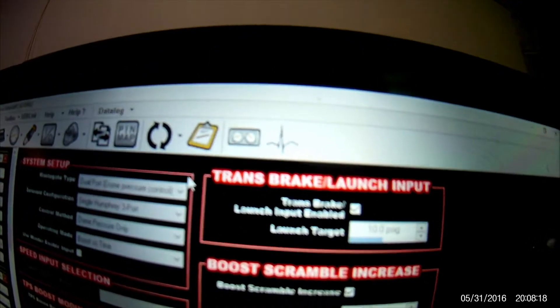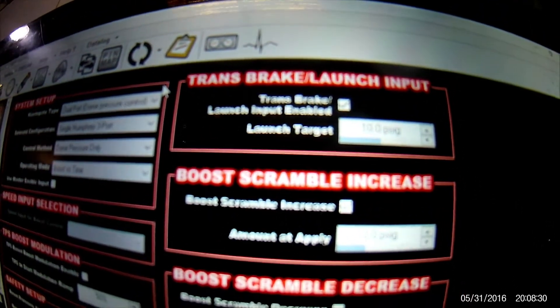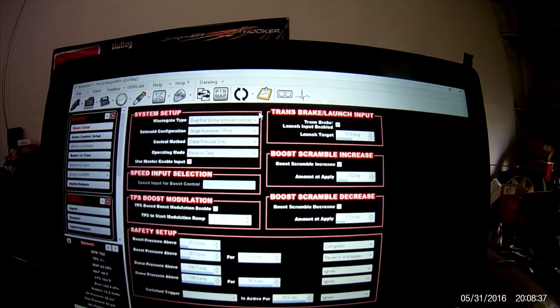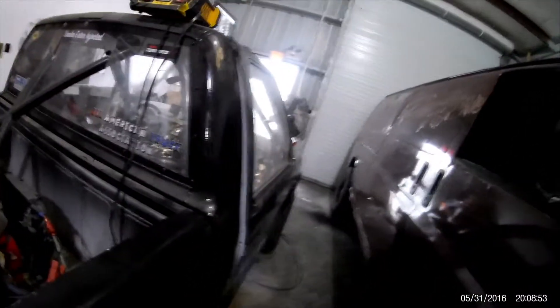It's really cool that it has a launch strategy — the boost strategy is super efficient on this. It has your trans brake launch input: you put your trans brake on and then set your launch target — 10 PSI is what I have set up for right now. Scramble I set for two PSI just to test it and make sure everything works. I'm hoping maybe early next week we get it up to the dyno, get it all back together, make a video of that, record everything, and go from there. It's a super simple system — you cannot go wrong. I'm Dean with Sear Performance — check us out on Instagram and Facebook, click like and subscribe, we really appreciate you taking the time to watch this video, thank you very much.